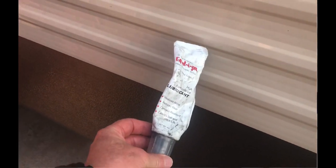I realize my hitch that I'm showing you is a little dirty and dusty — you should probably keep it cleaner than I keep mine, and maybe I should hit it with some touch-up paint. The main reason I wanted to grease the hitch is to keep the noise down and also help preserve the metal. If you've towed with a four-point sway control hitch that's not greased, you know what kind of noise I'm talking about — super loud, creaking and popping coming into the campground. I don't want to be that guy. The type of grease I use is the Equalizer brand hitch grease.